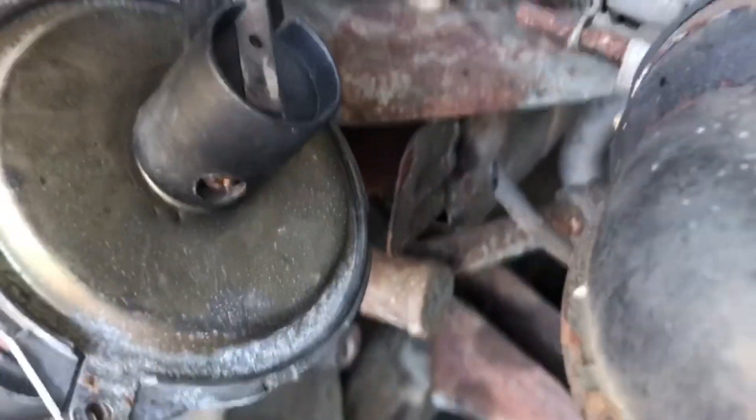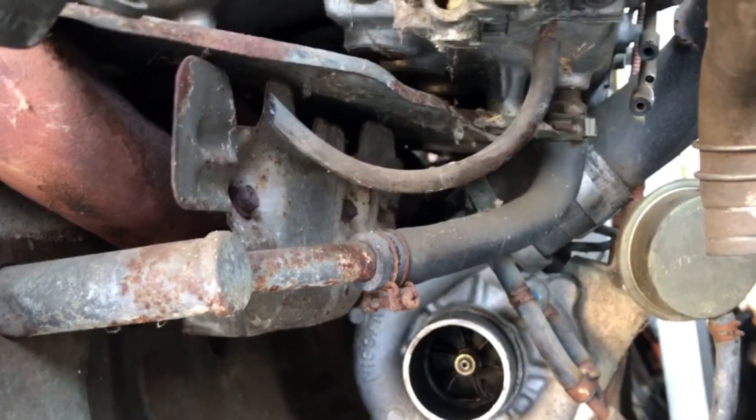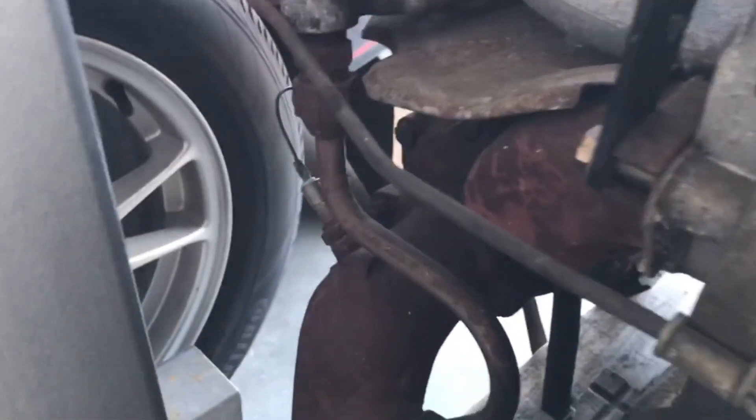The factory fuel rail is not high marks for me. Number four is the fact that this is not a crossflow head. On a crossflow head, we have the intake on one side and the exhaust on the other, which keeps exhaust heat away from the intake. Nissan and most non-crossflow heads do have some shielding between the exhaust and the intake manifold, and that definitely helps. But not having a crossflow head can be problematic.